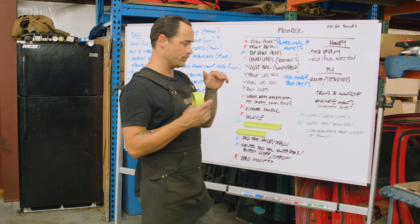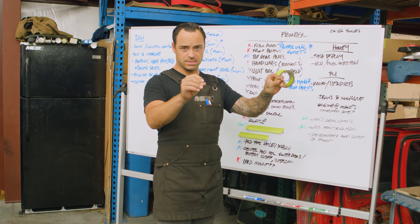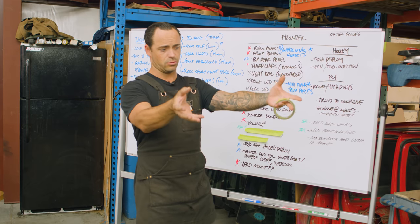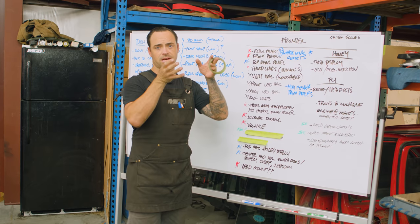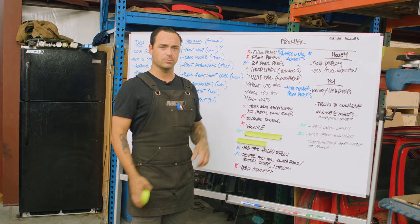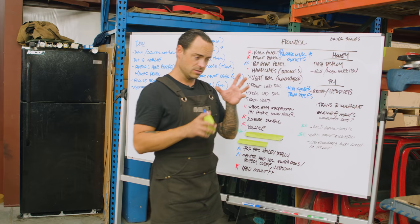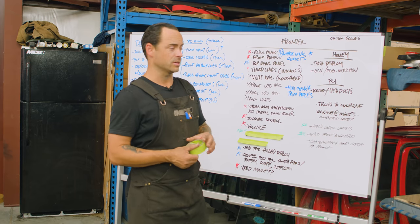There's a section around the C-pillar where the upper link ties in, and then the rest of the chassis draws out to the back half. I can see there's going to be a shear point there that's either going to have cracks or something's going to fail. It's something that needs to be addressed for sure.